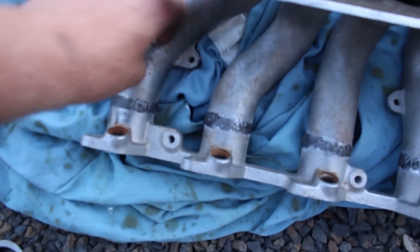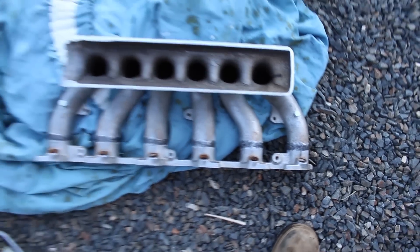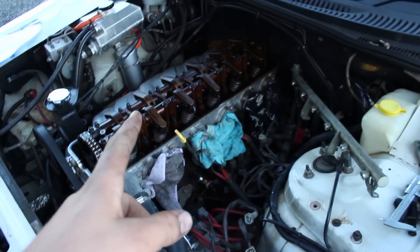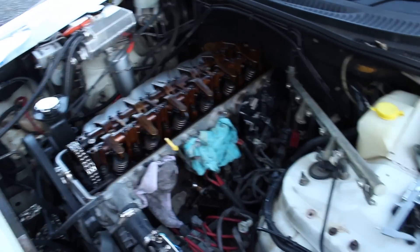Holes for the fuel rail have been drilled and tapped — quarter-20 threads, so they're all good. I'm going to take the manifold in to get it blasted at work. Now just waiting on the rocker cover to dry — we're going to put that on finally and then it'll be sweet. All we have to do is get that manifold welded up for next episode.